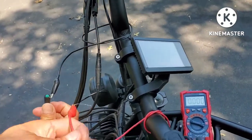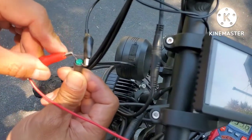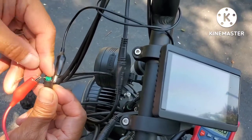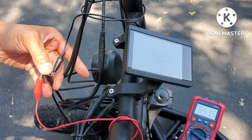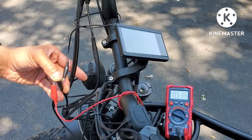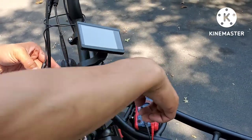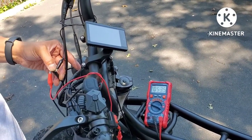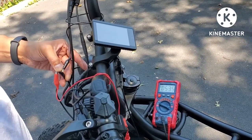And now the positive. It says try not to touch these wires together because you don't want to short everything out. All right, they're plugged in. He told you which one's positive, which one's negative — just use those two with the direction. So 53.6. We're getting the right amount of voltage out of this. 53.6, 53.5 — so yeah, it's about the correct level.